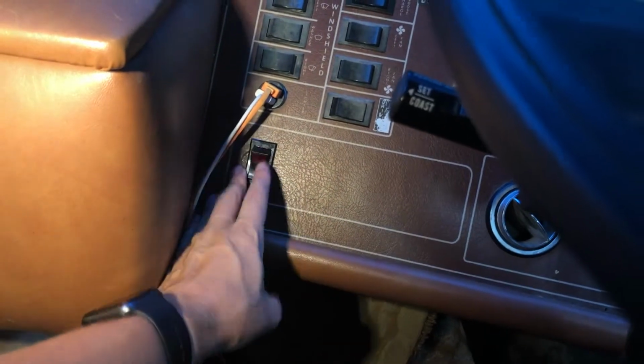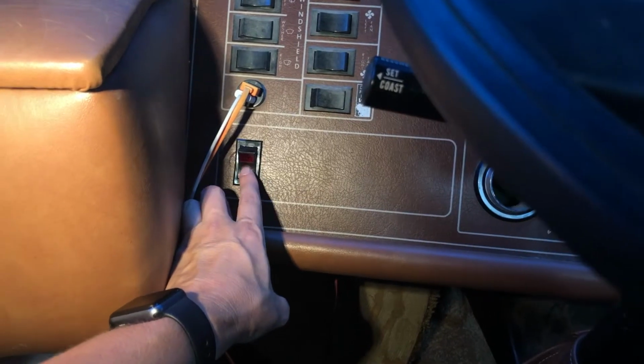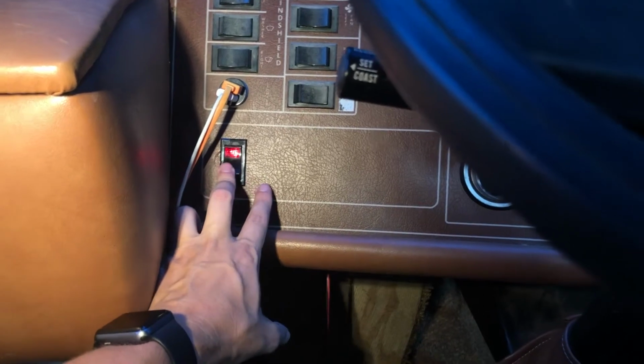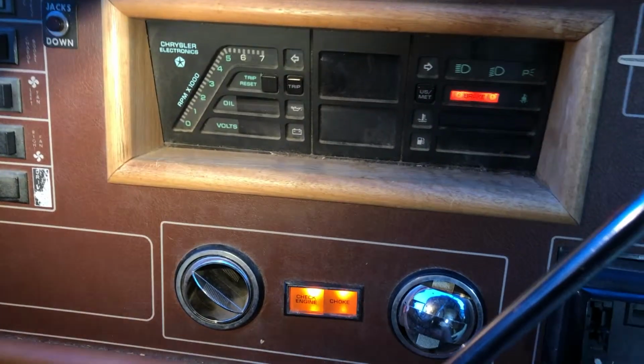And then if you remember, in the engine bay I told you I wired the auxiliary radiator fans off of the temperature probe onto a real switch. That's here. You can hear them kick on under the engine bay with a lighted switch that turns on and off. You've got your horn, your driving stuff. I'll show you here when you click it on.